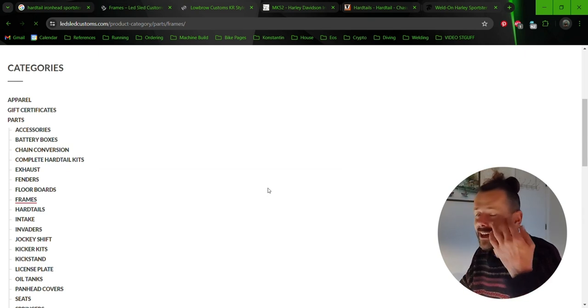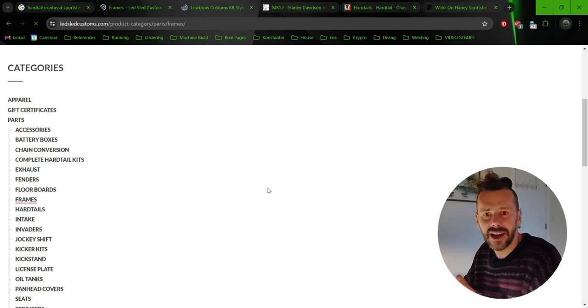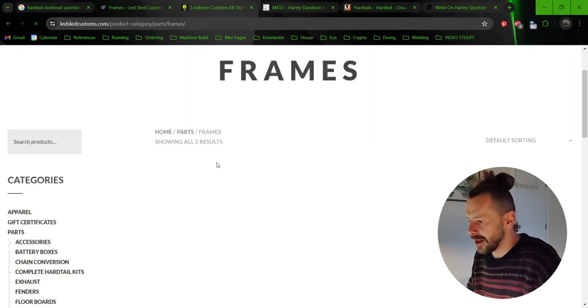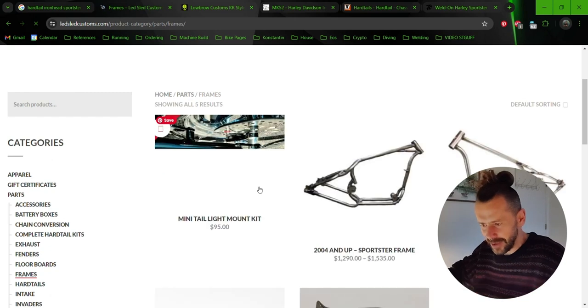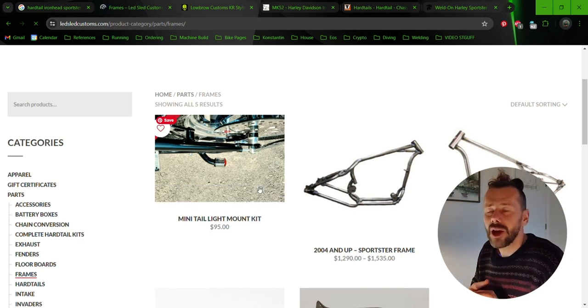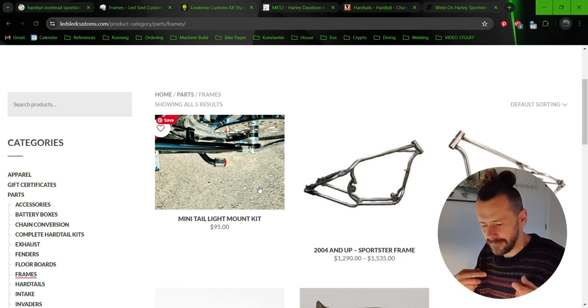what I want to say is that when I went to the shop, they told me that 1972 also, I don't know what year they changed the frames, but the early Irons, they had a very beautiful cast iron frames. Under the seat, you can see a massive wing which is made of cast iron, and which is kind of historical, beautiful. And I'm not exactly sure which year it was, 75 or something, or 73. They changed the frame, and instead of having the cast iron block, they just put a piece of thick flat bar, maybe half an inch, which they bent into a double L shape, into a C shape, and that became your new anchor for your rear subframe.